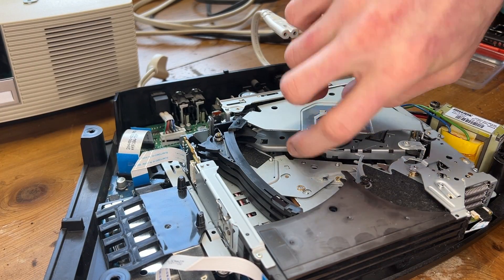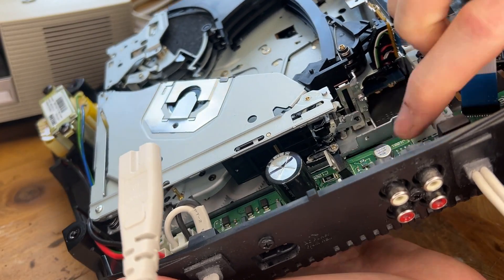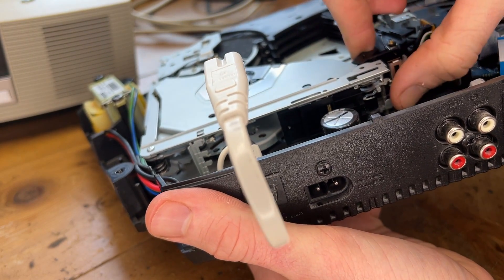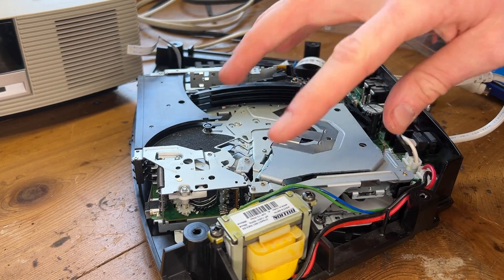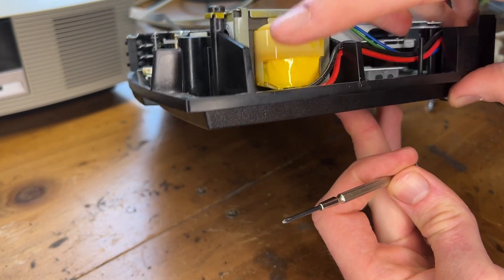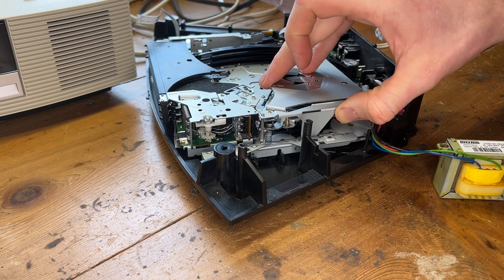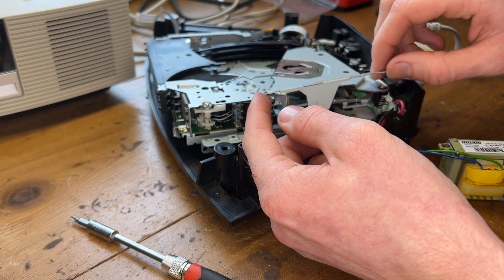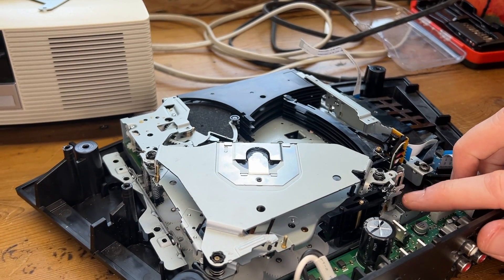This entire carriage is off-kilter. It's got a top and a bottom plate that have gotten out of sync somehow. The switch that tells it where it's at is over on this side here. So maybe it thinks it's lower than it is because that side is sitting low. I think I'll get this transformer out of here and then take the two larger screws, and then we'll get our top plate off. Maybe we'll just take that switch off.